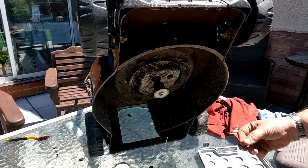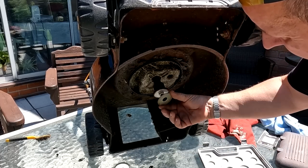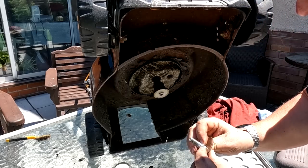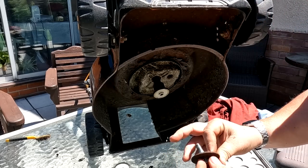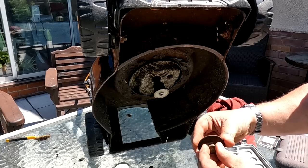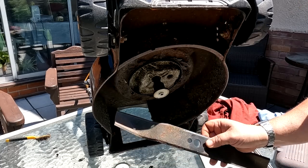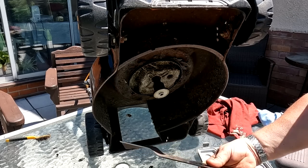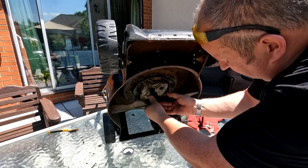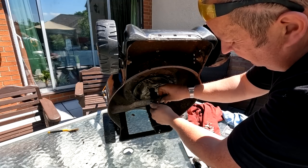Right, okay then, so you may see that there's no two lugs on this type of boss on this one, but it has got a fibre washer there, which should be on. And you've also got a domed, larger washer that sits on top of the blade, so that when you tighten that nut down, this pushes and compresses, and the fibre washer stops it from spinning. So don't forget, these shiny edges we just sharpened, and them little flicks go upwards. So we can put that back on there like that. Get our nice, newly sharpened blade in place. Just hold it in place.